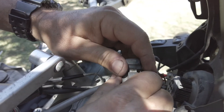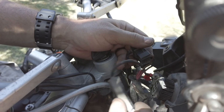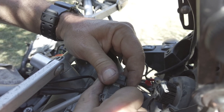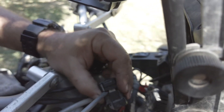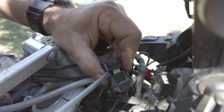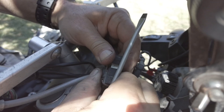This is the three-pin connector for the headlamp. Ours is a little different because we replaced our headlamp with a Cyclops LED, but the procedure should still be the same — just plug this three-pin into the connector. This connector is very difficult, so you might have to put some contact solution in there and gently, delicately open it up with a screwdriver so you can get it off. We'll clean this up later to make it easier.